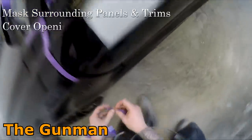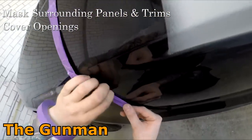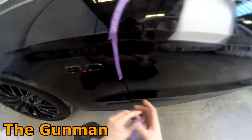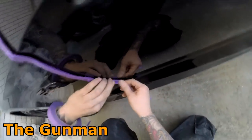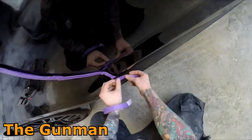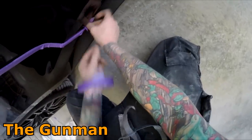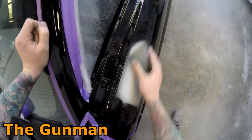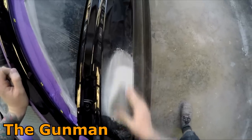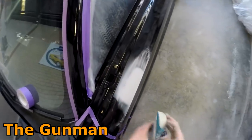Anyway, back onto the body of the car while that panel's out there drying off, and you can see I've just finished cleaning up around the edges, and I'm just going around masking off the panels that I don't want to hit. One person on my Instagram page said, oh, you didn't really leave yourself much room for a blend there, but on a black color or a really dark color like this, that's plenty of room for me to blend. If it was a silver or a lighter color, a metallic or something like that, well then yep, I'd probably want to go and blend into that fender. And the boss did even say, hey, if you want to blend that fender, you're absolutely welcome to. But I just decided, you know, it doesn't need it. It's just an extra panel to be painted on the car, and it's not necessary.